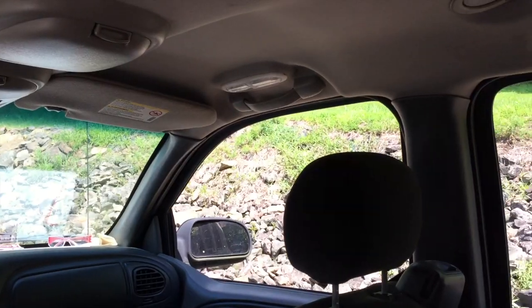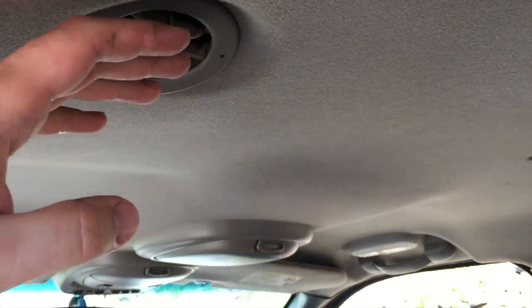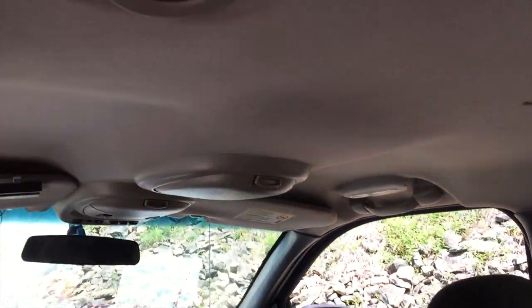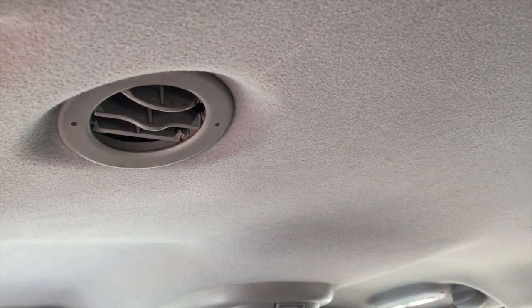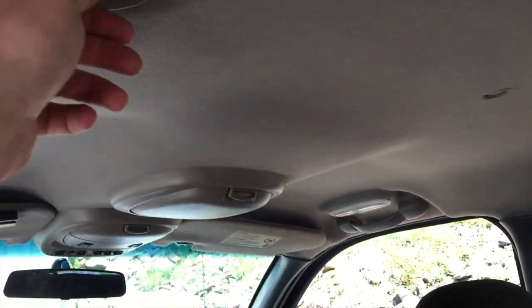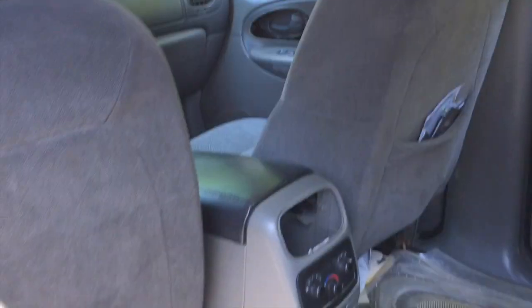The rear air has worked before. When I first charged the air conditioning last year, we took our family trip and had rear air no problem. But since then, the fan kicks on for like a second or two at a time, then kicks off, and it'll be a couple of days before it kicks on again. It's extremely intermittent, but the fan does kick on every so often.